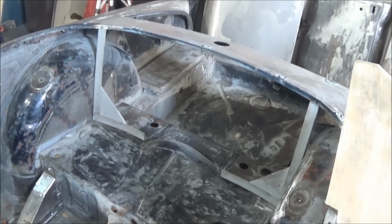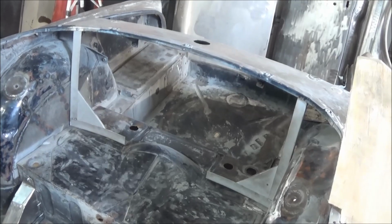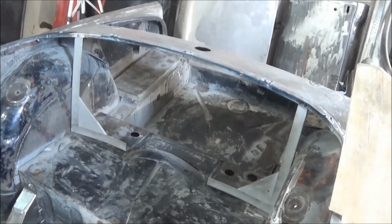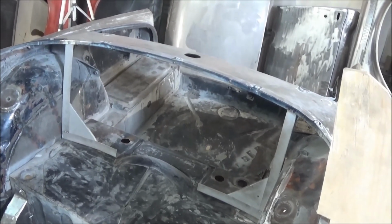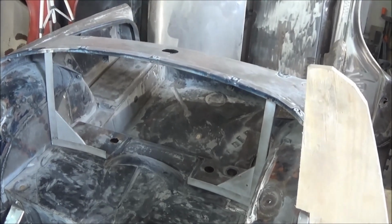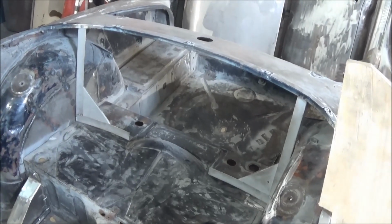It's Monday, February the 26th, and we are going to work on mounting these L-shaped brackets back in here today. These brackets hold the back panel for the cockpit trim, and I think they provide a little bit of stiffening as well for that upper saddle piece where it's spot welded against the wheel tubs there on the side.